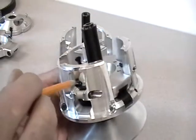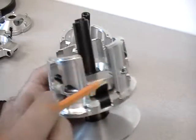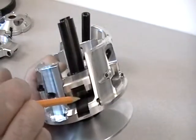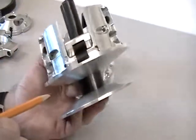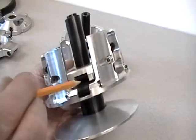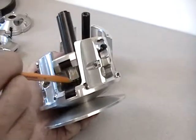What's nice about having the first stage arms is this overcomes any inefficiencies done with the spider shim. We can increase weight on these little guys to make up for some of that. We'll send you the clutch. What we like to see is there's a notch in these arms — at engagement point, at idle, we like to see that roller engaged inside that notch completely. Those large washers have to fit between the movable sheave and the spider.